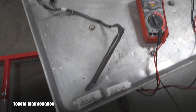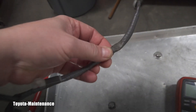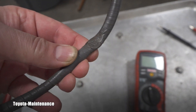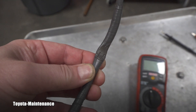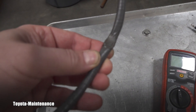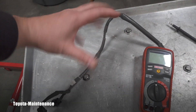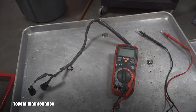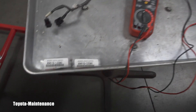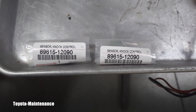Despite the fact the wiring harness is basically two months old, they are being pinched right here. So I immediately tested it with the ohm meter — the continuity of these wires to those connectors. But no matter how I bend it, it shows continuity and it's not being interrupted. So he might be right — one of those sensors is bad.